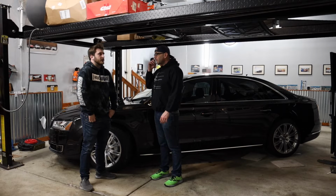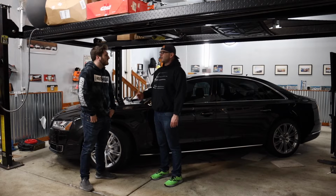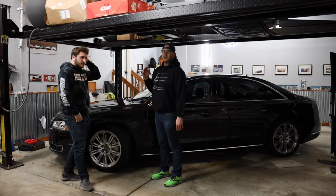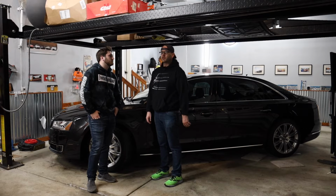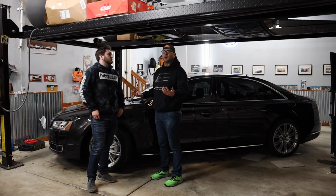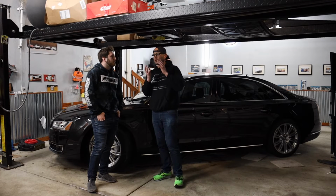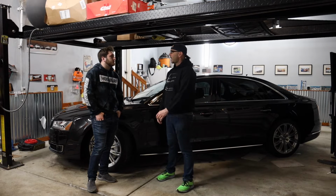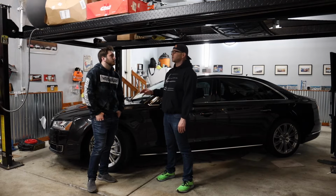Which a lot of people say around 50 to 70,000 miles when you replace them, isn't it? Yeah, it just depends. It's totally driving habits. If you're pushing the car hard, if you're in a lot of stop and go traffic, they're going to wear out sooner. I was estimating with the control arms that I took out, even though the cracking was very minor, I could have easily gone up to 90,000 miles before I was starting to see something.